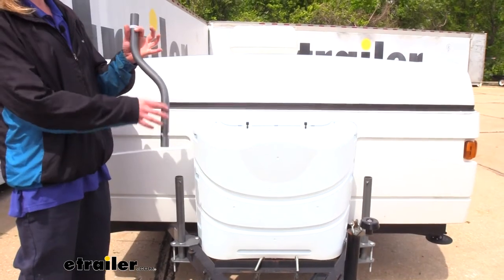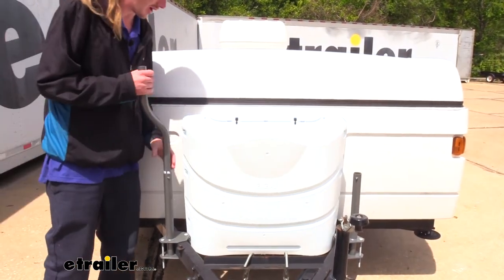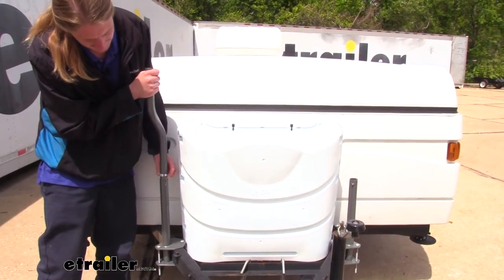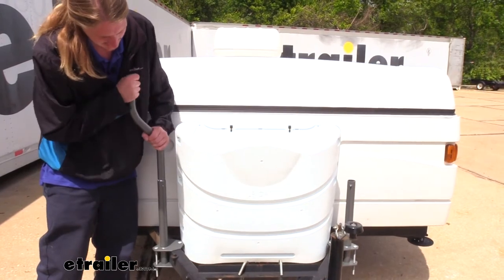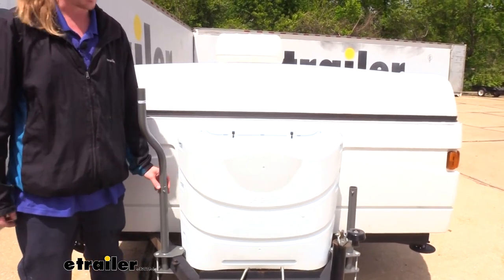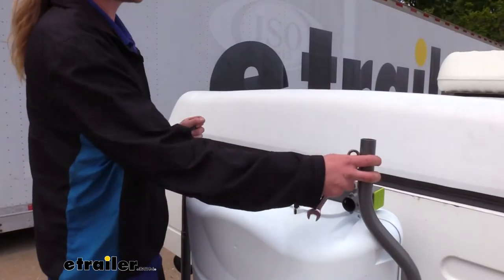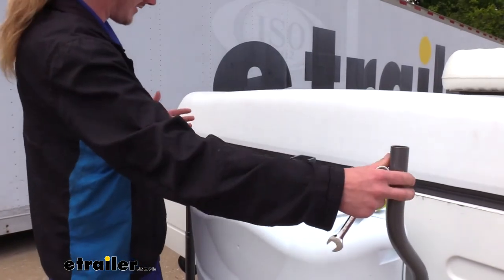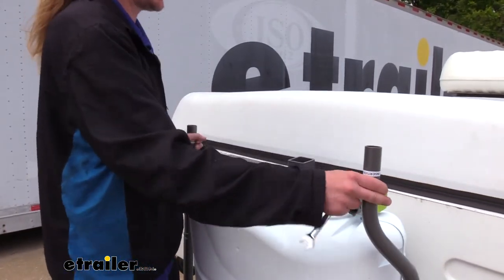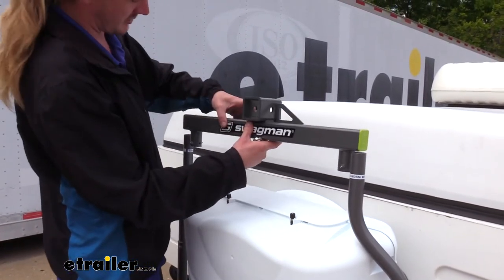We can now take the S-shaped arms that come in our kit and slide them down into our ends attached to the trailer. You will see a sticker on them indicating the minimum insertion distance — we need to make sure we go in at least to where the sticker can't be seen anymore. A little bit of it may peel up when pushing it in. Now we want to check our top arms and see if we have a decent position — they do pivot around. We're turning them in as far as we can, but we're hitting our propane tank cover and the arms aren't in far enough.